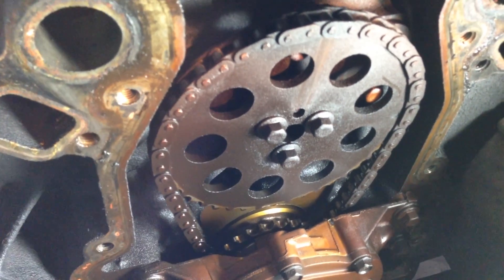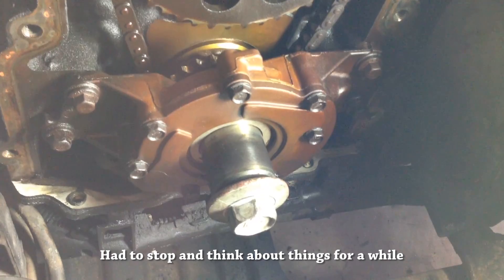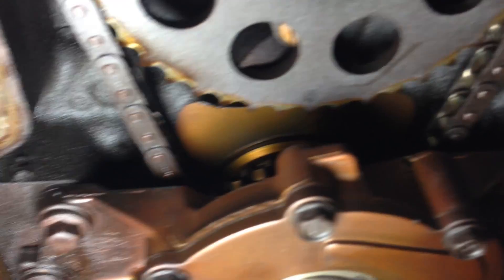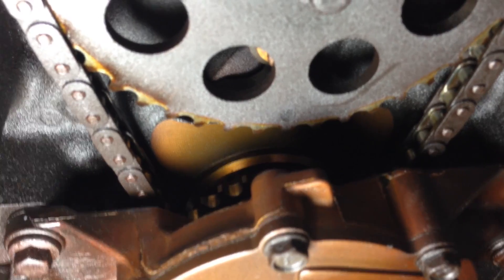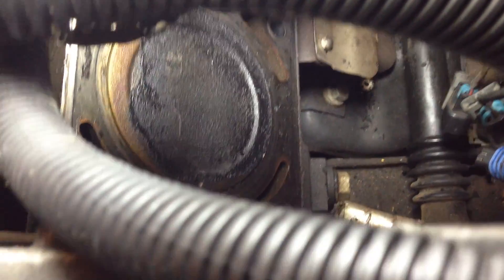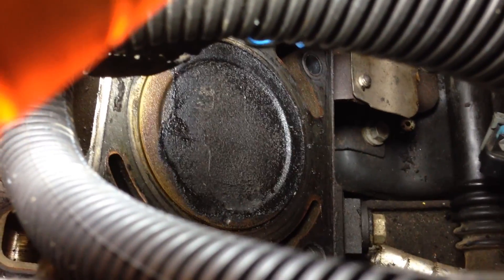In order to feel like I had some sense of accomplishment, I'll take the top timing sprocket off. Before taking the timing sprocket off, I made sure I aligned the little notch at the six o'clock position. I'm guessing the other sprocket is lining up with it — I can see it's straight down at six o'clock, which also means number one cylinder is at top dead center. And there's our number one cylinder — it is at top dead center. That looks like the proper procedure.